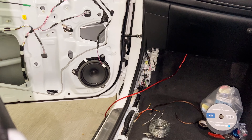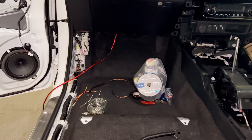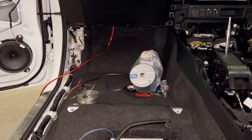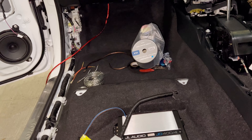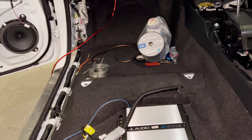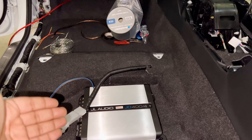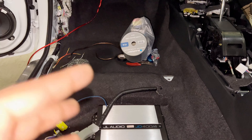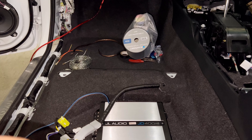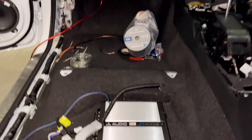We are adding the speaker wiring to each and every door. We remove the speaker wire from each door. There is an option to take the speaker wiring directly to the head unit, but there are a lot of humming issues with that. If you remove the wiring from each door and run the speaker wire from each amplifier, we will make four separate routes for every door, and there will be very minimum humming. The alternative option saves time but gives chances of humming, so we are investing more energy to eliminate humming. Right now we are installing the JL Audio amp and two pairs of C2.